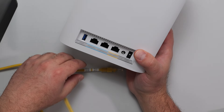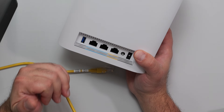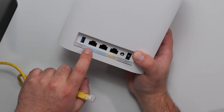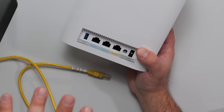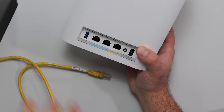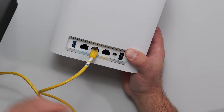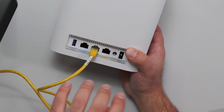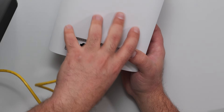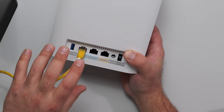Which port do you connect the Ethernet cable to? If you have internet speeds of up to gigabit, you can use either of the two blue ports. If you have internet speeds faster than gigabit, use the 10-gig port — connecting to the gigabit port would cap your speeds to gigabit. For example, at home I have 5-gig internet speeds, so I connect it to the 10-gig port, which allows up to 5-gig speeds. The 10-gig port can handle up to 10 gig; connecting to the gigabit port would automatically cap speeds to gigabit.